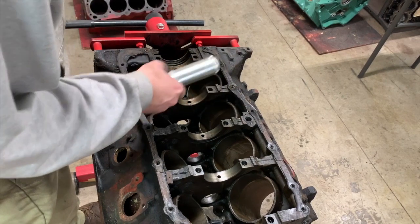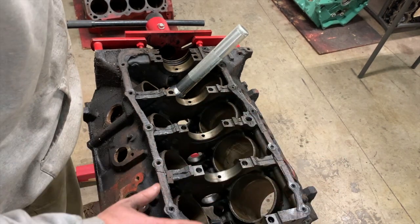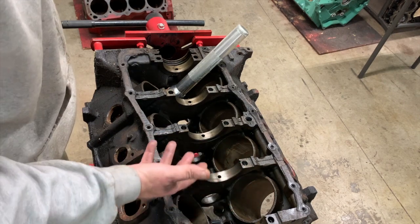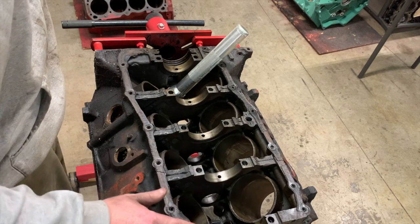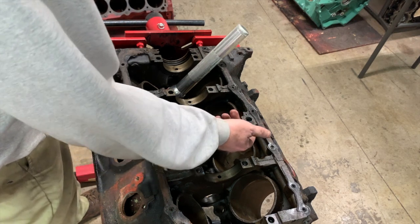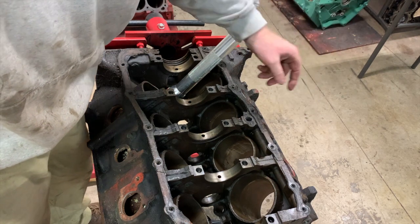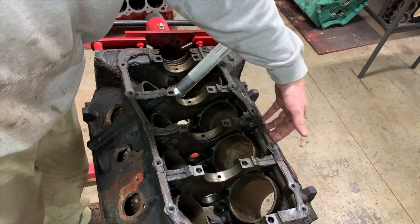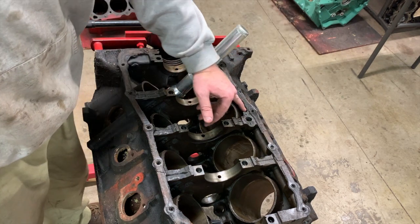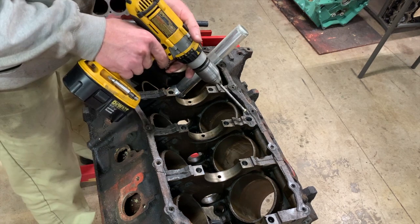The big difference with this passage: if you looked at the 350 Buick, it's a deep-skirted, wide-block style design. The 455 Buick is not — it's missing essentially two to three inches on the deck that would make it a wide-block design. This is where they saved casting material and made the block lighter. Since everything's been moved two inches, your motor mount bolt holes are not in the way of the pickup tube. The pickup tube is essentially two inches further up than on the 350 Buick, giving you plenty of opportunity to radius this turn and open it up for maximum flow.